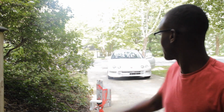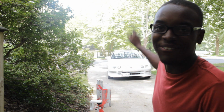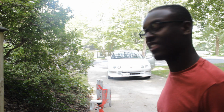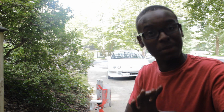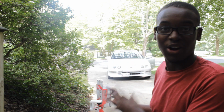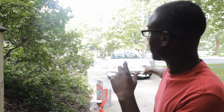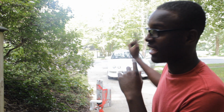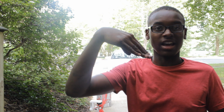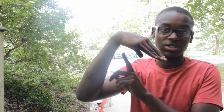Okay, everything's done. The car is way back there because when I tightened all the wheels down, and the last wheel that I did, first off, let me back up. So if you have 4 jack stands, in order to take the car down with a small little $50 jack like that, you have to first jack up the front and take off the 2 front jack stands. After that, the car is going to go down like this, okay? So you're not going to get that rear tow hook with that little jack, you're not.